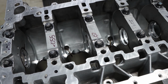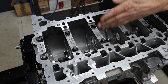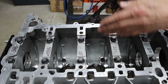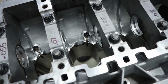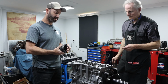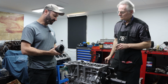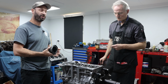And yes, just be aware, and everybody that doesn't know, the crankshaft is offset to one side on the N20, like some other more modern engines as well. So that's the reason why you've got the notch on one side, not on both sides, because the actual crank offset is significant on this engine. So we'll bring some more content to you guys just to show the product and result once it's all in, and hopefully we can lock this one down as being a good, robust option for the N20.